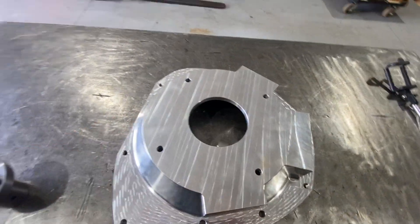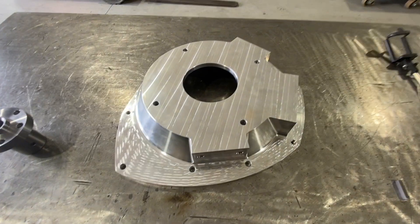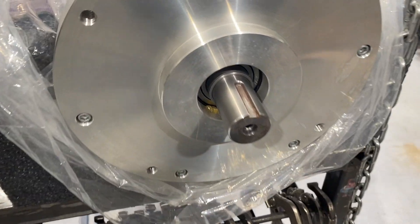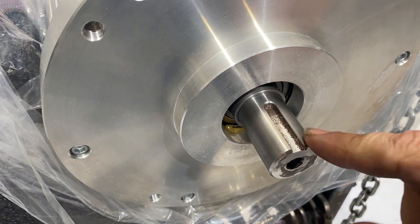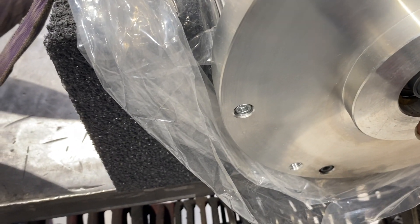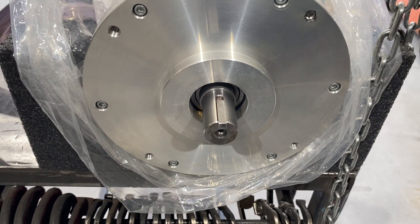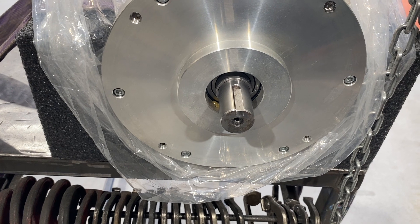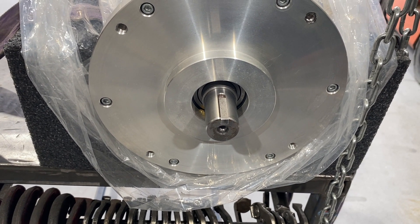I was going to work on the car outside in the tent and do some smelly stuff out there — bogging and so on — but I can't help myself, I've got to put this together. Okay, step one: I am going to put the coupler onto the shaft. I'll just clean it off with some Scotch-Brite first, and then the key way sits in here. Get the coupler, put it in the oven at 150 degrees C, get that up to temperature, then pull it out of the oven, bring it over, and tap it onto the shaft — or it should just flop onto the shaft — and then let it cool down.